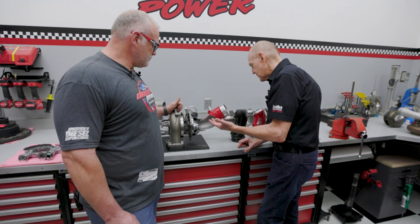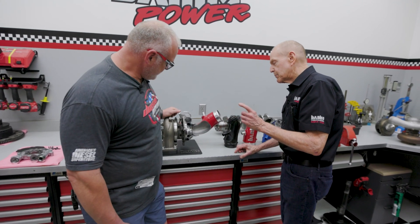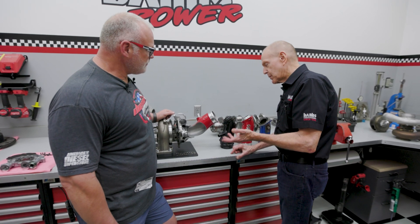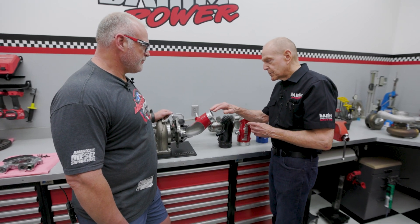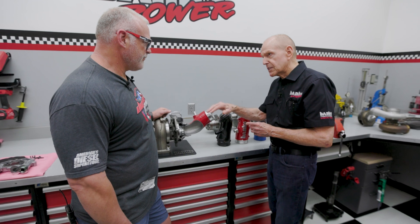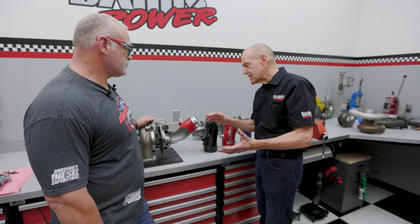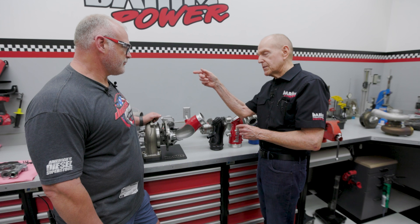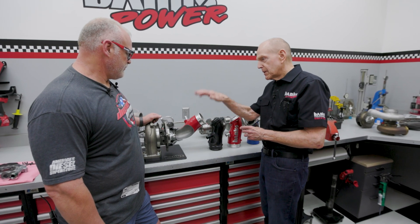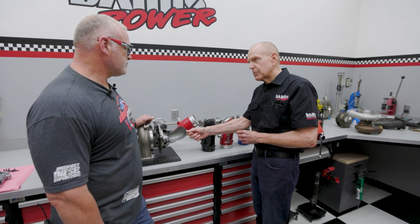If you mess with that — and there are a few ways to do it — you increase the surge. You can also get a surge problem at high boost. Testing an L5P on our chassis dyno, the first time I felt it, the nose of the truck literally bounced about six inches. This is just this backward pulse of air — whatever it did to the engine's speed, the horsepower just goes whoo and then it comes back. The nose of the truck is going up and down because the horsepower is going up and down, and you're at wide-open throttle.